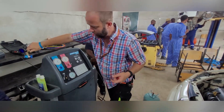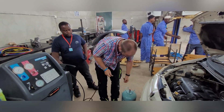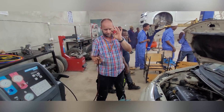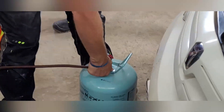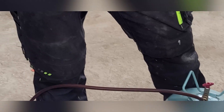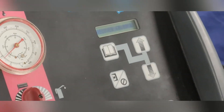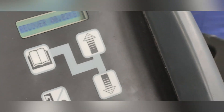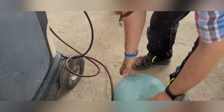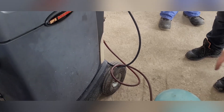So you buy the gas, you release this valve, take it off, put the head right away on it, connect it here, open the valve of the tank, and push down here which says 'recover.' Now it actually sucks the gas that is inside, and to make it quicker you place it on top of the head — this way we take the gas inside the system here.